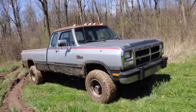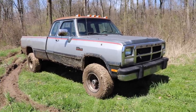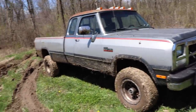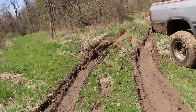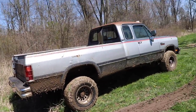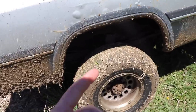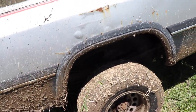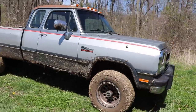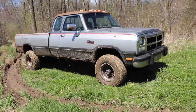First attempt to use the four-wheel drive on this truck — in four-high without the hubs locked, it pretty much didn't do anything; I don't think either of the fronts were spinning at all. I was actually getting stuck on the hill. Then I backed the rears into the mud pit and, with the front hubs locked in low, it locked in, grabbed, and pulled right out. The only downside is the tires are very low on tread — they're Mastercraft mud terrains and they're worn out.